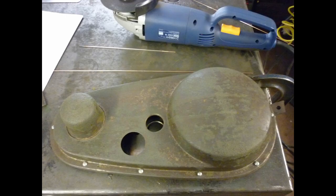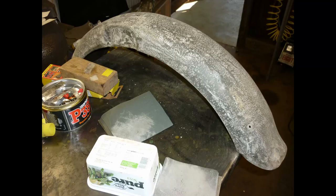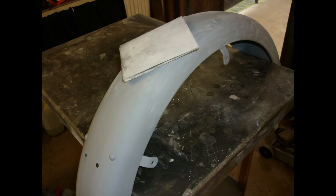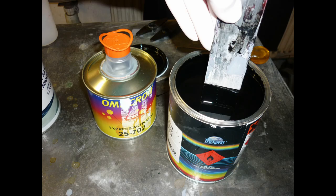Cleaned and repaired tinware and new unplated rims are given a coat of two-part etch primer and hung up to dry. Grey high-build primer follows, rubbed down between coats. These vary in number, depending on how the surfaces come up and how fussy I am on the day. Filler is added as appropriate. Feather off around fixing holes. Two-pack acrylic, 2-to-1, has proved its durability for me.